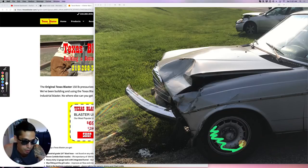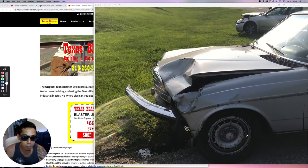You would spray it, take off all the old paint, prime it with a nice 2K primer. All right, and then you'd be able to spray your base coat and clear coat on your rims there if you wanted to do that. Okay, so that's how I would tackle the job if you wanted to do that. And I mean, that's pretty much it.